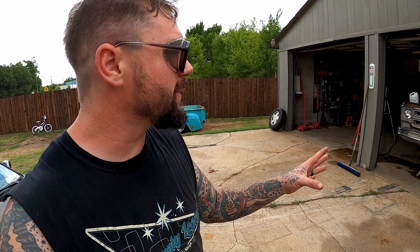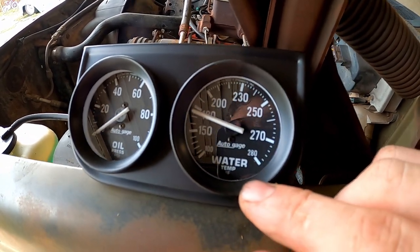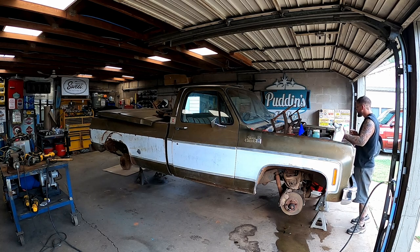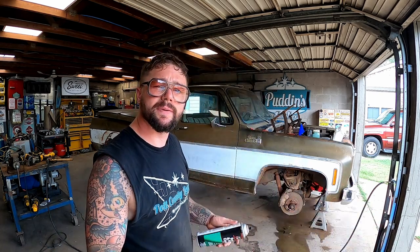Spraying the carburetor and vacuum lines is a little tricky because it is idling up a little bit - we have a vacuum leak somewhere, but I can't tell if it's the base of the carburetor or all them little vacuum hoses. She's creeping up to about 180. I pulled on my hose going from the PCV and our valve cover to the front carburetor - that sucker popped right off. That's right where our vacuum leak is.